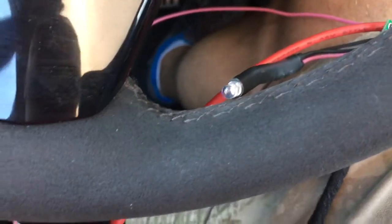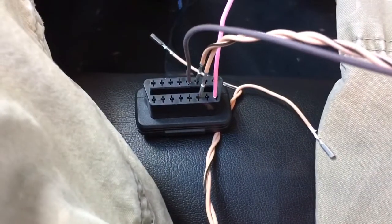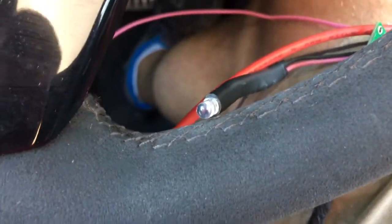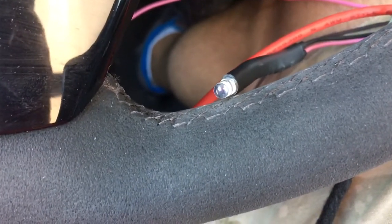The other thing that's pretty neat about this is it's going to listen to the CAN bus. You can see right here I'm actually tying into my OBD2 port right now to pull all the data that I need. The controller is going to read the CAN data and look for two things: one is that the pump is requested to be on, and two that pressure is at least requested to be 500 kilopascals.